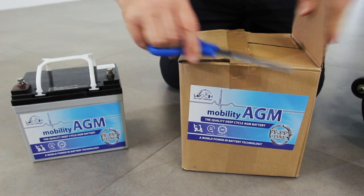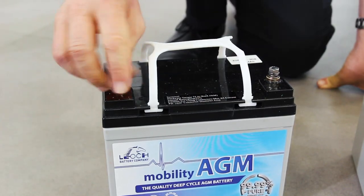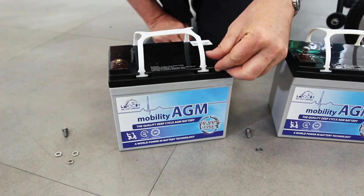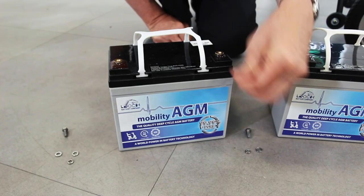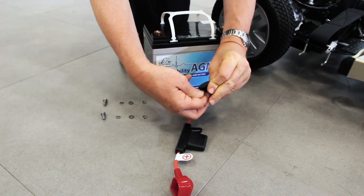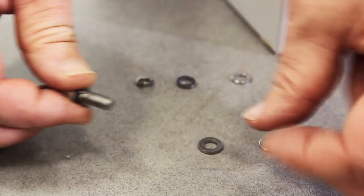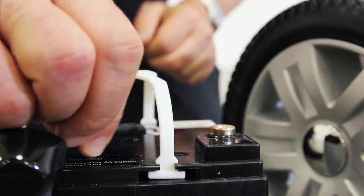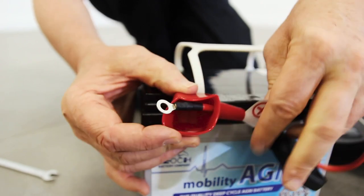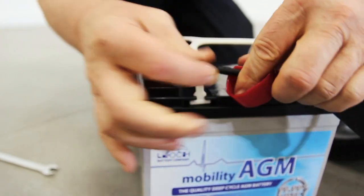This scooter requires two 12V 34Ah sealed lead acid batteries. Once unboxed, remove the screws on either end of the battery to unlock the terminals. Make sure you keep the screws with their respective washers. Take a cable and push the rubber cover back to reveal the metal ring on the end. Now you can connect the cable to the battery. With the washers realigned with the screw, feed the cable end under the handle and connect it to the terminal on top. Make sure the black end of the cable connects to the negative terminal and the red end is connected to the positive terminal.